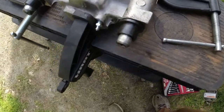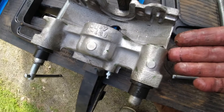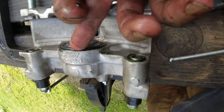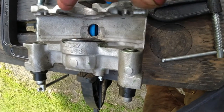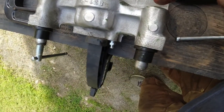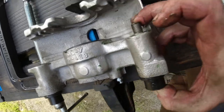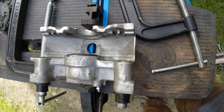The final result: we've got a brand new bleeder valve in here. The outside has been sandblasted and wire-wheeled down to restore the finish. The seals and dust boots have been replaced. We've checked out the piston to make sure it is salvageable — if there's any kind of corrosion on there, you would of course want to replace it completely. We've replaced the slides and the grommets to make sure the slides move back and forth with ease. This is ready to be installed back on the vehicle.